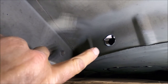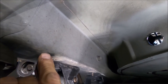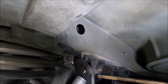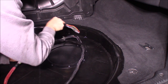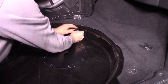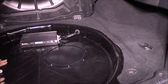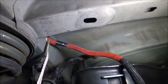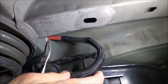Right here you can see the hole I just got done drilling through. Now what we've got to do is come right over here and drill another hole into the unibody frame. Got a nice hole right there — now I'll be able to pass the harness through from point A to B. I ran a fiberglass electrical push rod up here to get that pull string in there, and now I'm pulling the cable back into the frame and up to that hole I showed you earlier.